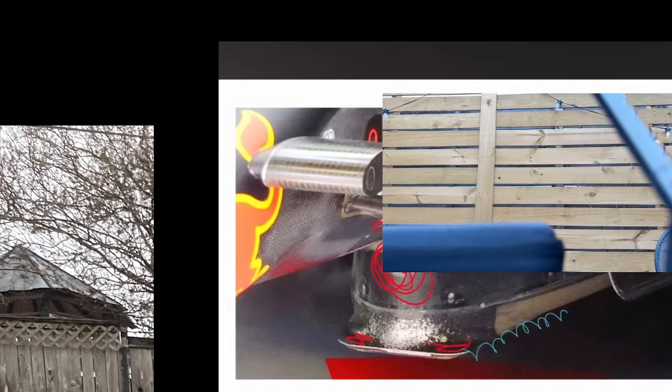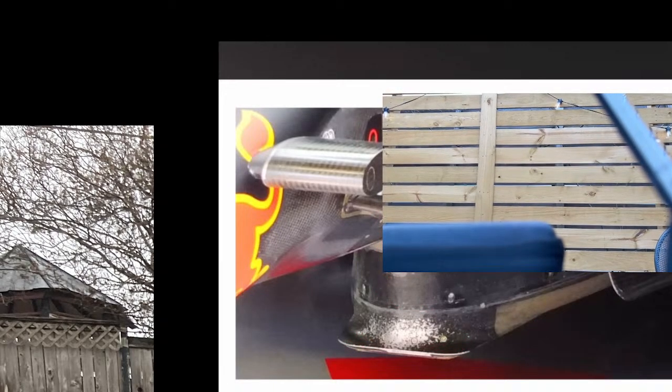So why would Red Bull want to use this solution? On paper, it sounds like it's not great. What I reckon they're doing is playing around with their pressure distribution in their forward tunnels. What I think is going on is that if you have a really fat section through here where you maximize your pressure at the front, you're then already wide from this point back. So your curvature profile from top down will look something like this, instead of something like